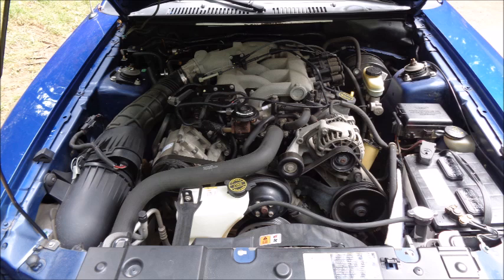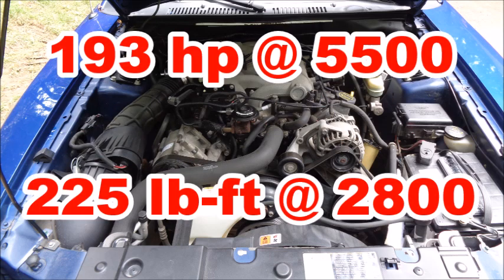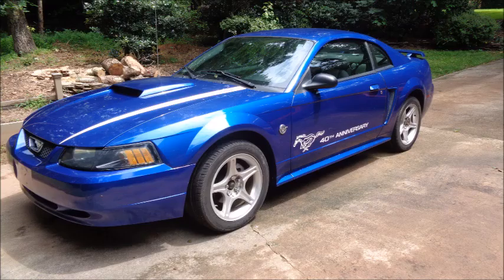If you're in the market for a V6, you'll want to listen to the valve train. These cars are notorious for ticking due to bent pushrods. There are also rubber grommets on the valve covers for the PCV system that degrade and cause air leaks that affect how the engine runs. And the factory headers have a tendency to crack and cause exhaust leaks. The 3.8 is a tough, torquey little motor, and this one seems to have all its ponies and power intact.